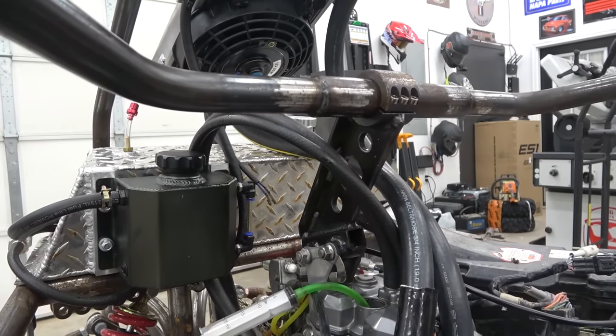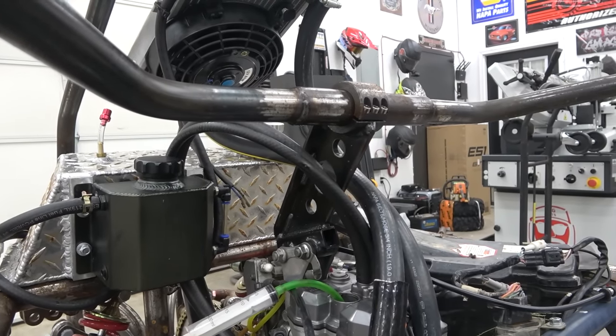So the way I set this engine up is it could slide to chain tension up the chain, but I'm actually not going to slide it because there's too many factors with an engine like this to be able to slide it. So what we're going to eventually do is build a manual chain tensioner that we can loosen a jam nut, tighten up the bolt, and set our chain tension as it stretches. So we made this I-beam style 1/4 inch thick upper engine support, super strong, and it should keep it from just rocking side to side, like torquing the top of the engine.